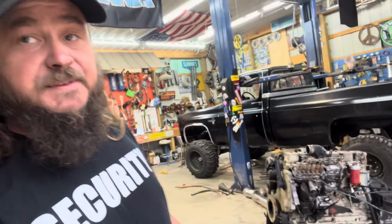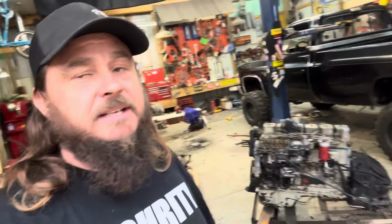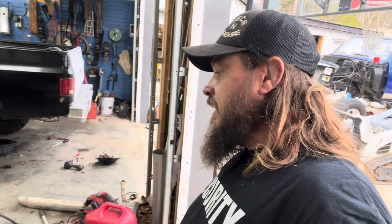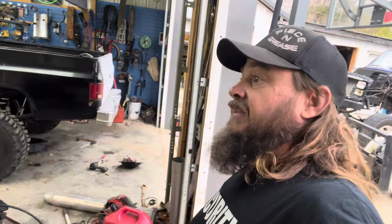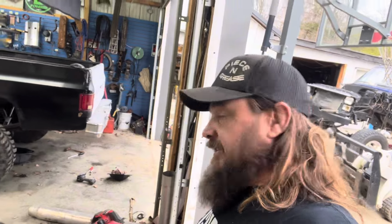will run. And if this runs, then we can start the process of flipping the oil pan around, getting the right pickup, making it more pickup truck friendly, because as of now, front sump oil pan, it's not going in anything we got. It was in a giant truck with a giant straight axle, and I have read you can flip the pans around. I'll just have to do some investigation into the oil pickup on that. Probably just a pickup truck pickup will work. So let's hear it run.